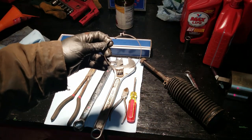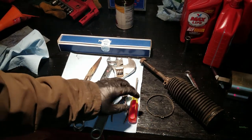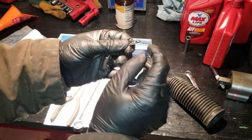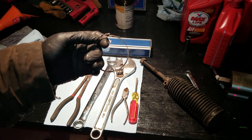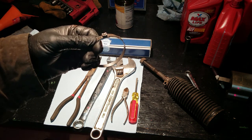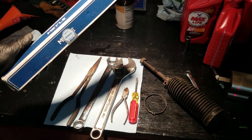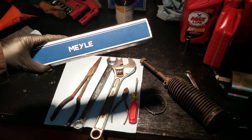If you're going to reuse this clamp you're going to need a screwdriver and a pair of wire cutters to spread this area back open, which will allow you to bring it back in, lock it down, and then squeeze it to tighten with wire cutters. If you're not going to reuse it, you can order a new one from the dealership, find them online, or use a zip tie, which is very common. I went with a Meyle replacement tie rod here. You can also go with Lemforder or Moog — really any reputable brand. I went with this because it's the cheapest.